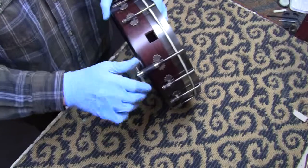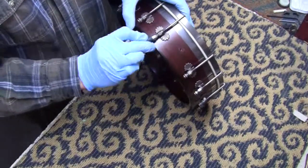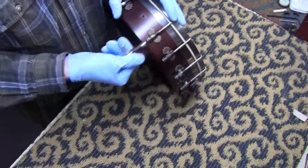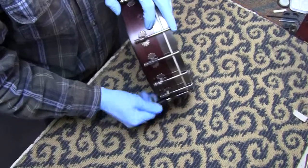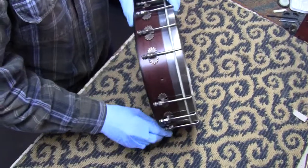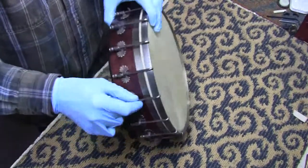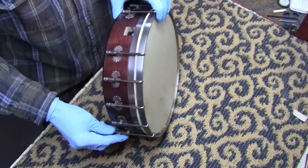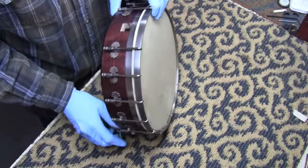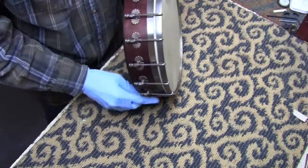So around the dowel stick hole, around the end bolt hole. They're still pretty tight, but I'm not forcing them. And they're not excessively tight. And then I'm going to the outsides and just looking, as you start tightening these hooks, you can see how the head's coming down. Okay, everything's looking even. This is a little high over here, so I'm going to get that one.